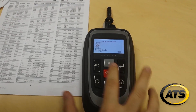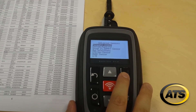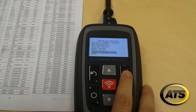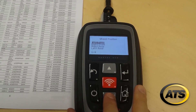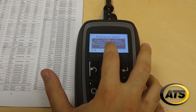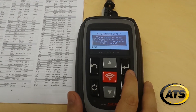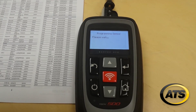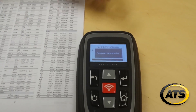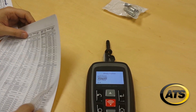We're going to go to Program Sensor, select Ford F-150, 2014, then go to Schrader Easy Sensor, Program, and Create ID. You're going to see here — this has the new update — it says place the 33500 or the Black Easy Sensor, but we're going to do this with the new sensor and program it. So now we've got a confirmation that this is now a Ford F-150.